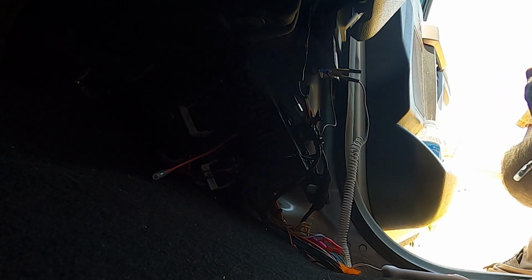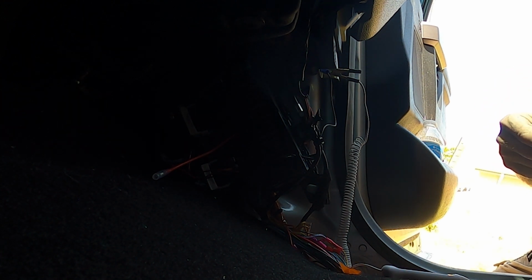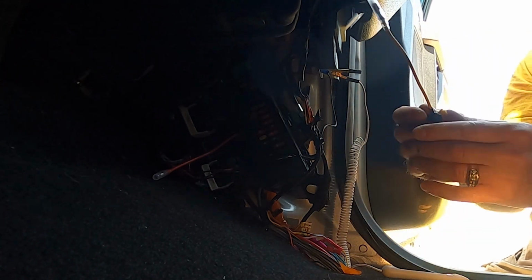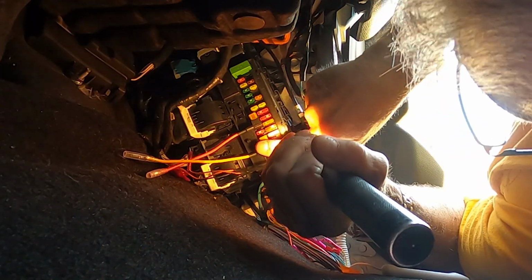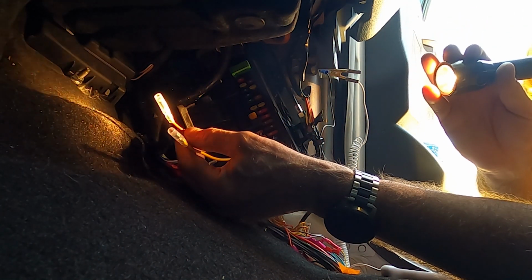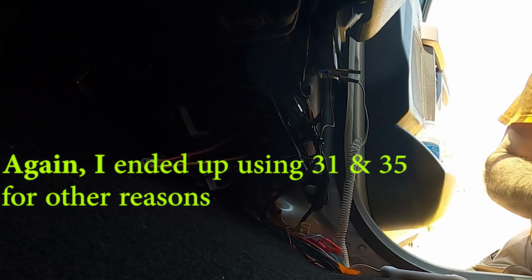And we're going to put that fuse in the bottom, which right now doesn't matter, because in this particular case the add fuse came with a 5, so they're both going to be 5 fitting in there. So let's put number 5 back in, align, and push the seat. Okay, so now we've got the constant power, which is red, and the accessory, which is yellow. Back in.